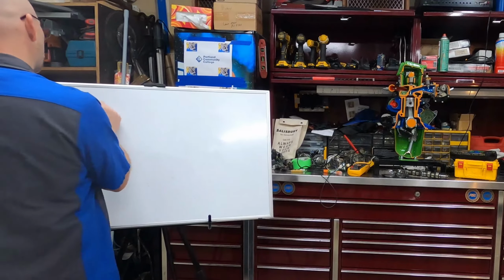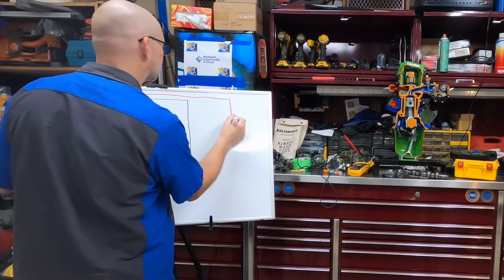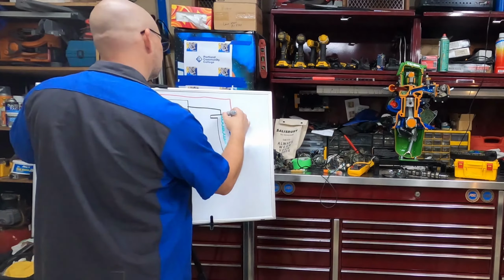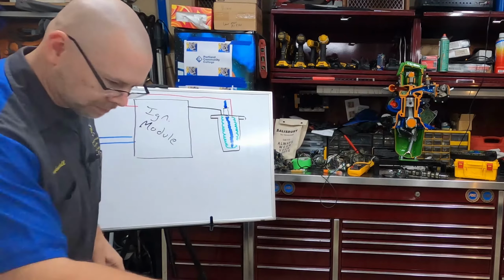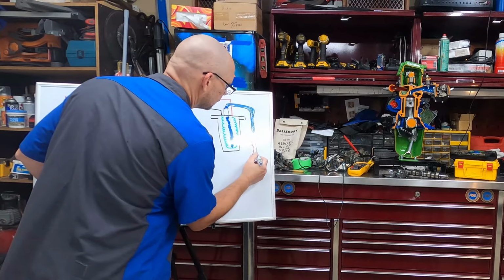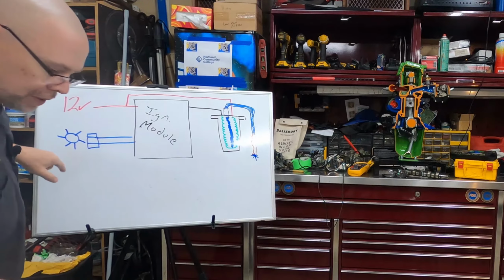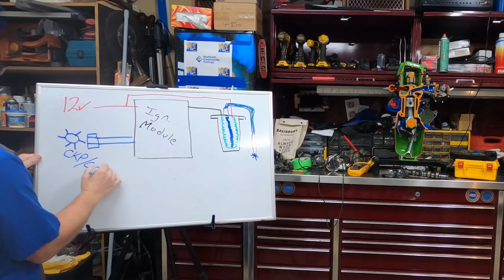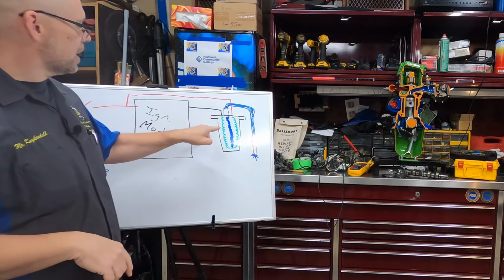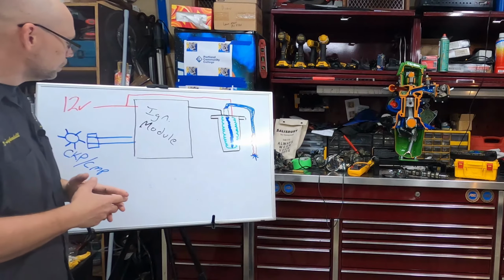So, in our complete circuit, all right, we have power, trigger, switching, transistor inside some form of ignition module, secondary, including ignition coil, spark plug wire in this case, spark plug, pretend that's a spark plug, and finally spark. Put it all together.